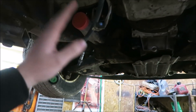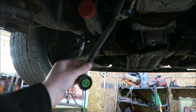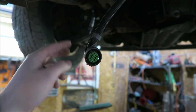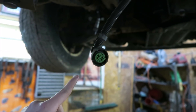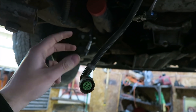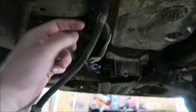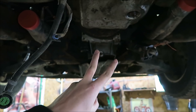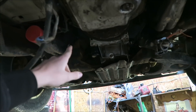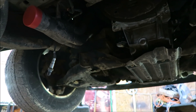I was going to go with a conversion harness from Nelson Performance, but it should be simple enough to just tackle it myself. On the round transmission connector you just have to remove two wires, switch one to another section of one of the wires you removed, and then connect the two you took off to a speed sensor plug. The 4L80s have two speed sensors while the 4L60s only have one, and you'll find those wires up in the actual PCM pinout and move those two — that's it.